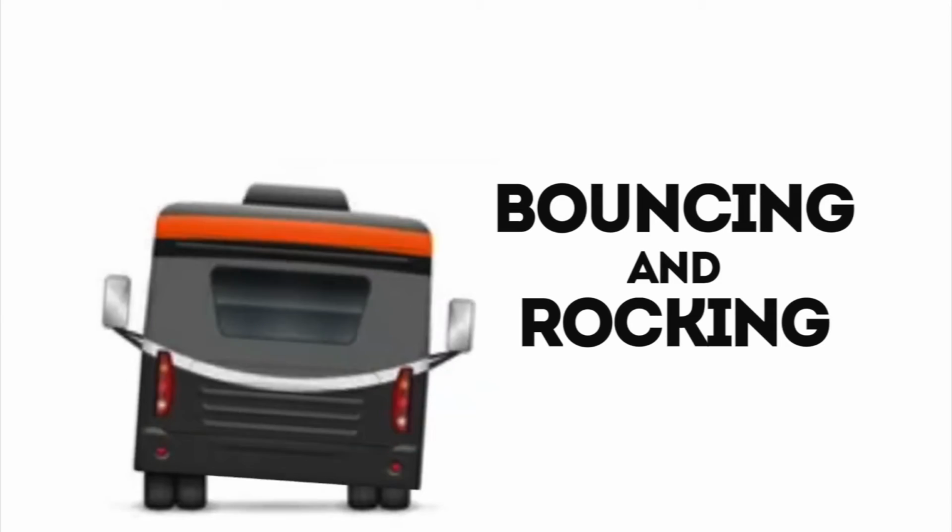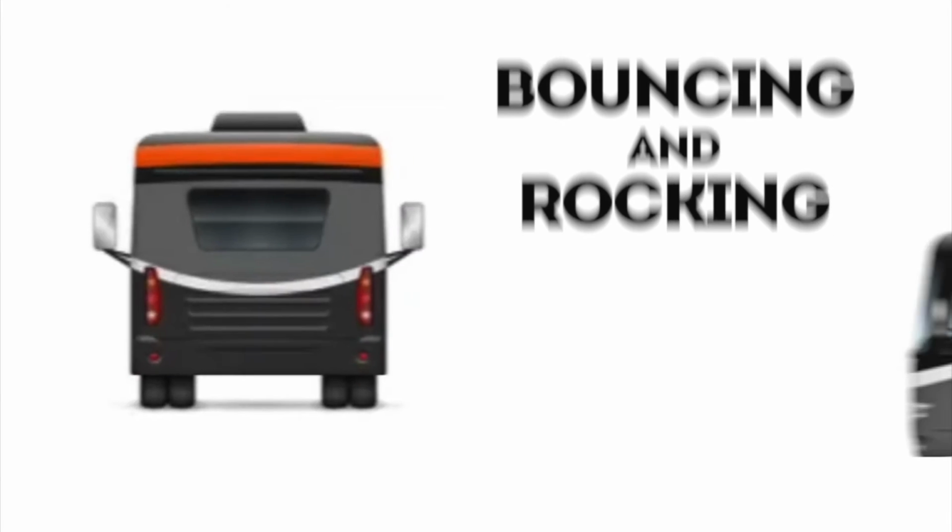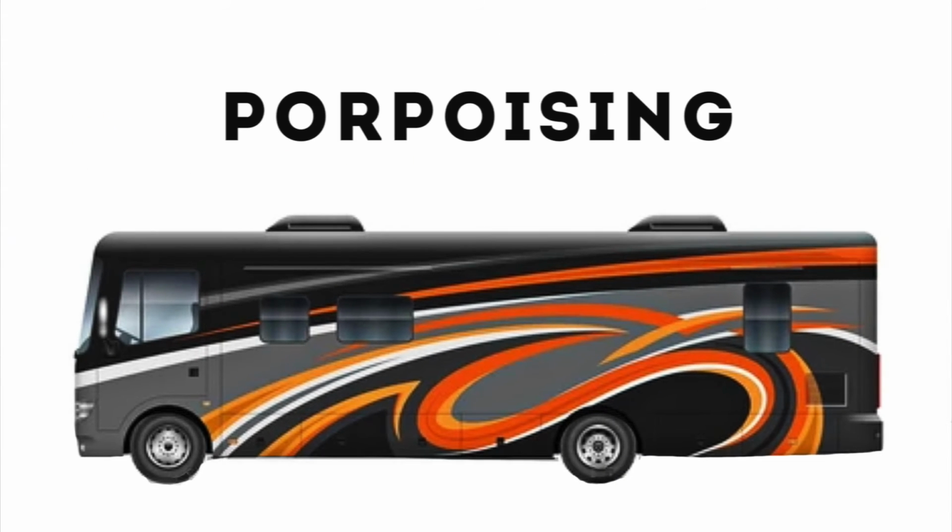So now we've covered most everything related to the suspension on these, but what about the shocks? Where do they fit in? Well, that's super important. The shocks are really critical in these to control the body movement. If they aren't functioning right, you can get a lot of bouncing and rocking, especially on the shorter wheelbase, to get the porpoising. Okay, our 98 Chieftain definitely fits the category of short wheelbase.